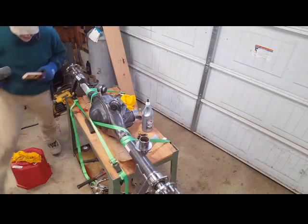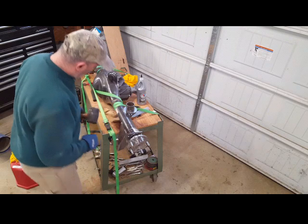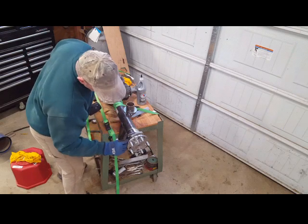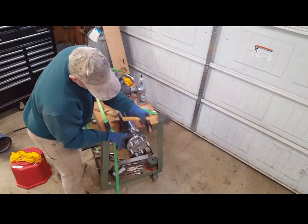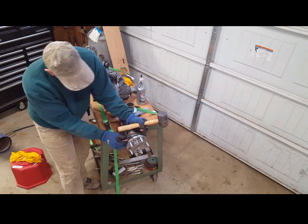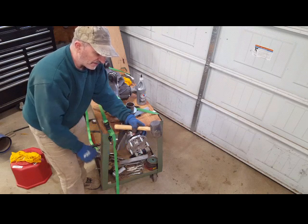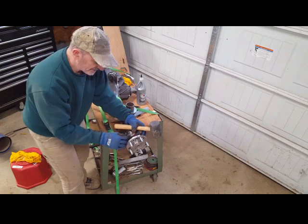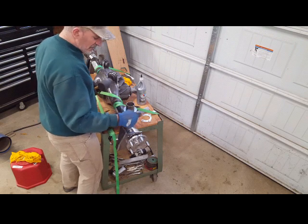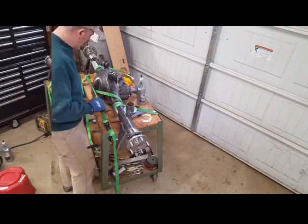These collars here go over the axle and you bolt them together so the rear axles don't come out. That axle bolt should be torqued to 35 foot-pounds. You come in through the hole in the axle flange to tighten it. I want to make sure the axle is seated far enough in before I use the retainer plate, so I'm not using the seal to push it.